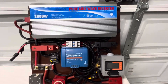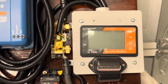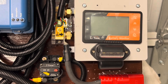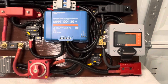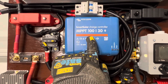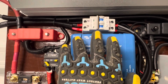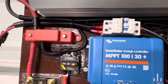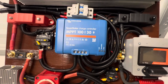As you can see, this one here has a monitor — it's a lifetime monitor. What that tells you is the voltage of the battery, how many amps, and how many watts are coming into the system or how many you're putting out. And of course, there's a light up under it. I went back with another Victron solar charger. And here's an on-off switch for my solar panels. The solar panels are going to feed in on this end, come back across, and run down through these two wires — red and black — and go into the solar charger.